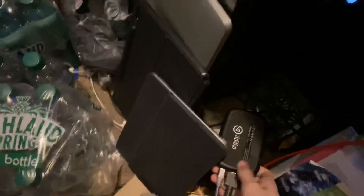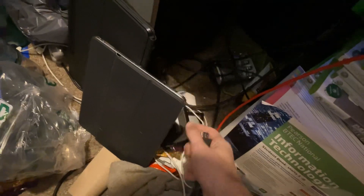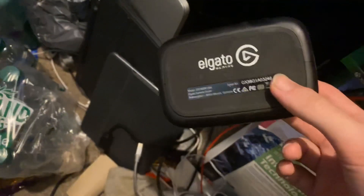And then what I did afterwards is I unplugged my USB cable from my Mac and then I unplugged all the connections — so I unplugged the USB-C and the HDMI, literally everything, and then I just gave it a good ten seconds or so, just to make sure everything is reset. I looked on the Elgato site and thought it wouldn't work, but it did.